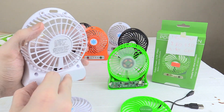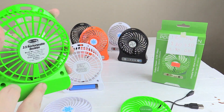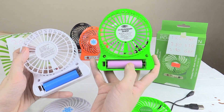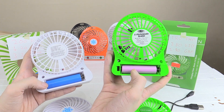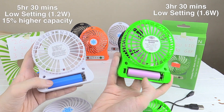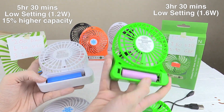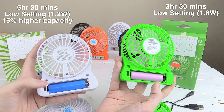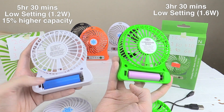The next thing to consider is battery life or battery capacity. This is very tricky because there's absolutely no way of knowing the capacity without doing proper measurements. Even if they write the capacity on the battery, you can never trust that because often they just lie. In my testing, the cheaper one ran on the lowest setting for three and a half hours. The more expensive one ran for five and a half hours on the lowest setting. I've done multiple tests, and I would have to assume that this more expensive one — the one that's an extra 20 pesos — has a higher capacity battery, giving you an extra two hours of run time. That's a huge difference.